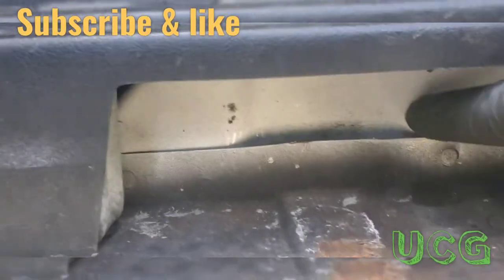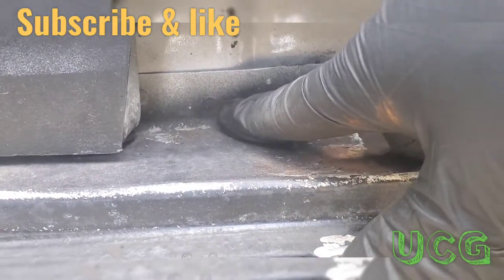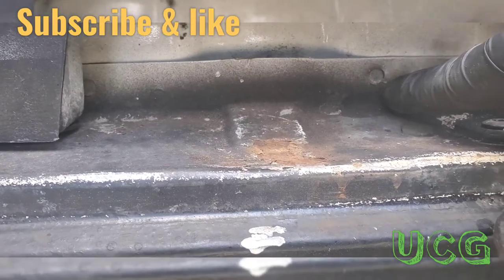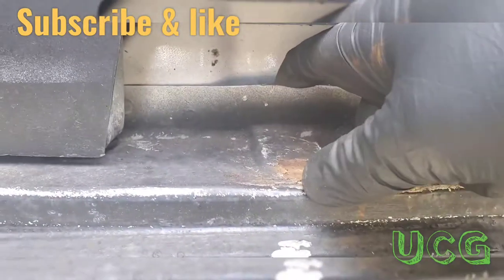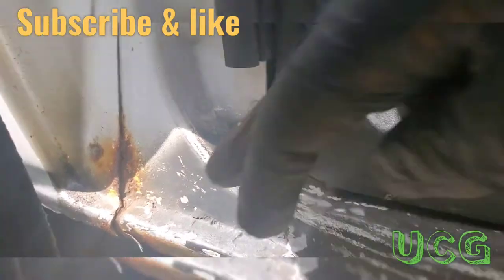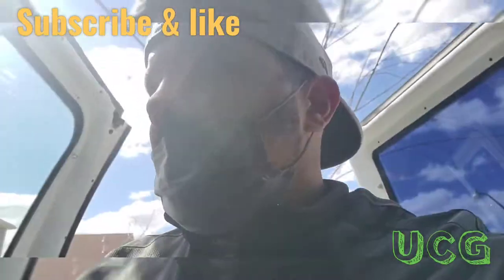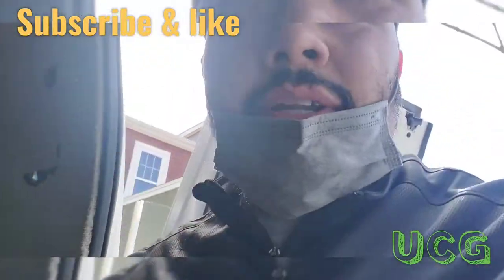The rocker is right here — you can see it right here. That's where you drill them out. It's got welds here, welds here — you drill those holes out, pry it out, and it comes out all the way from this corner to the front of the door. Then you gotta get that back corner pocket too.